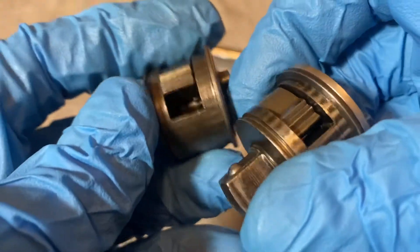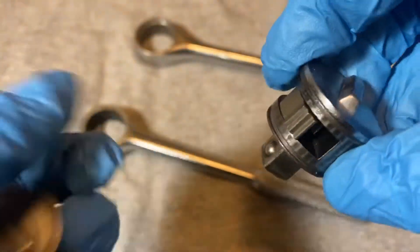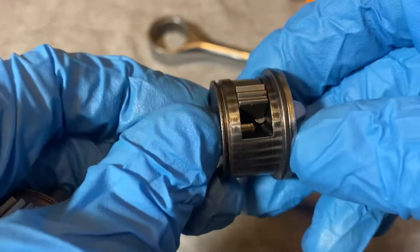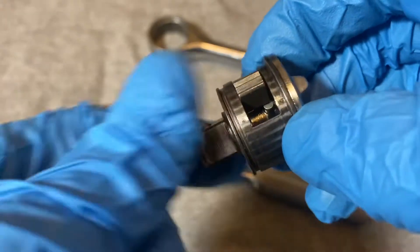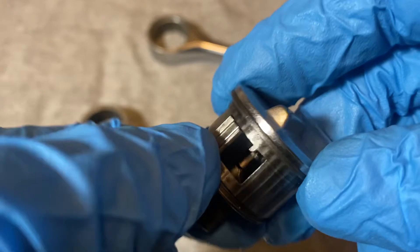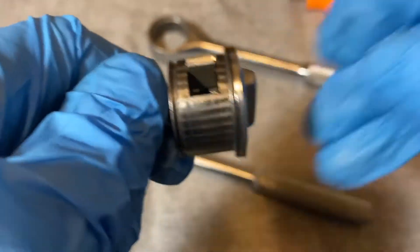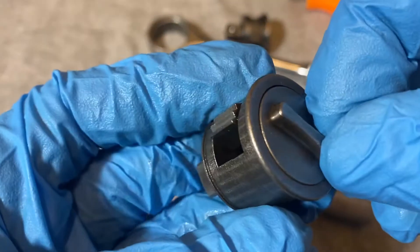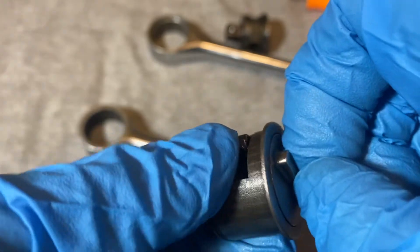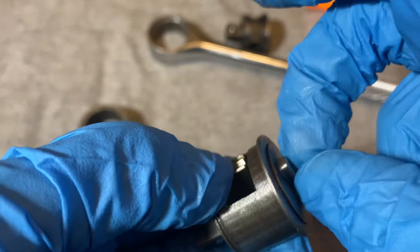Basically to tear these down, they're the same — internally they're identical mechanisms. I did a full teardown of this Dayton, so I'll put a link in the description below to show you how to tear them down — they're pretty much the same as far as teardown. This one might be a little harder to tear down just because to separate this switch you just have to get your nail underneath the switch when the plunger is down and it comes out easier. The other one, you can't stick a nail down the crack when the plunger is down, so you have to find a way to get enough grab on that little protrusion to shimmy it out.